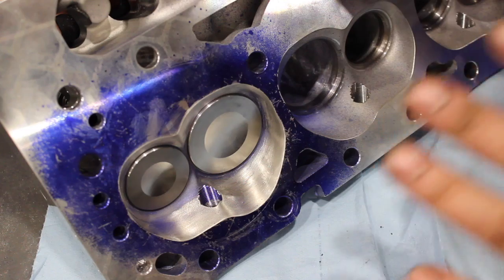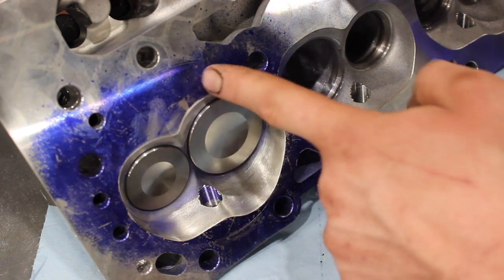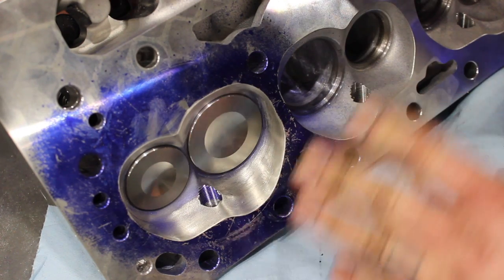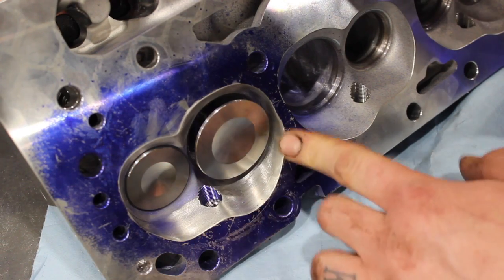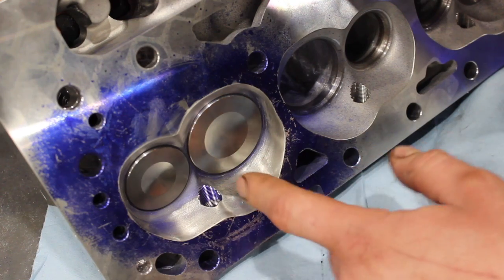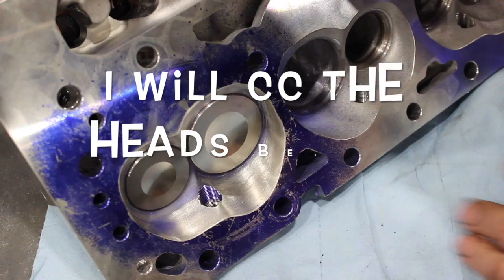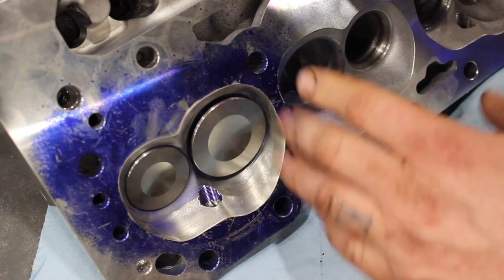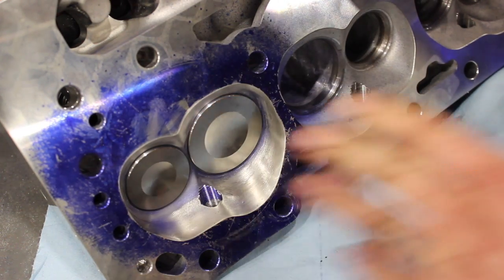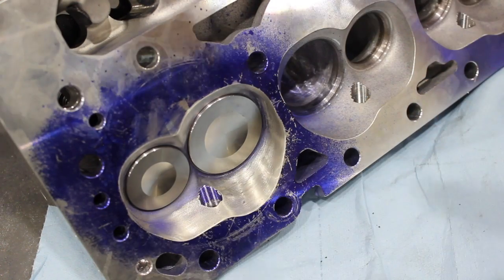The last part I did is just a little, very minimal chamber work. I opened it up just a little bit right here and then blended it down. I scribed to the gasket line and brought it semi-close to the gasket line, then just blended it in. I didn't want to do too much chamber work — I did not touch the exhaust side, just the intake side. Be careful doing chamber work that you don't nick your seats. For this application I'm trying not to lose too much compression by opening up the chamber too much. I just wanted to help a little bit with flow and get air around the valve — it's called the power dent right there. So with a 1206 gasket, a little bit of chamber work, our valve job, and port cleanup, let's take a look at our final results.